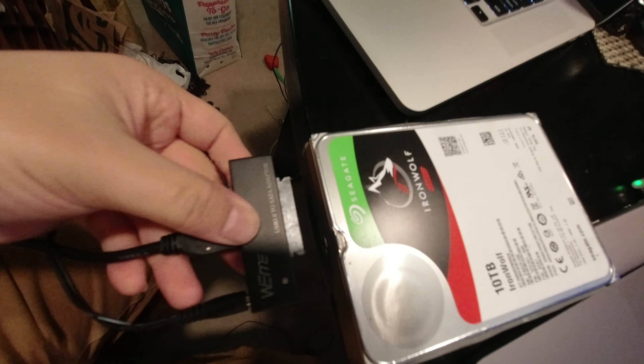So I bought this — it's a SATA hard drive adapter with a wall plug and a regular USB-A plug. I'm just going to plug the hard drive in, connect it to my laptop, format the drive, and then I'll be able to see it as a blank disk and tell the NAS to use it as a replacement drive. This thing is like 20 bucks on Amazon, and I'll need it because I have four more drives to format after this one.